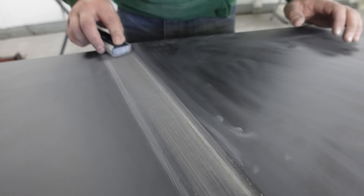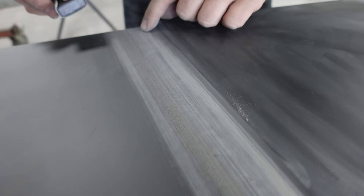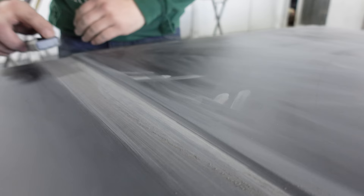You don't need a guide coat for black primer - super handy. You can see that run is in there. I'm putting pressure down with my finger here, but not anywhere else on the block, so it's not doing any work the rest of the block. Small bits at a time.